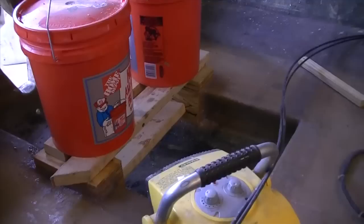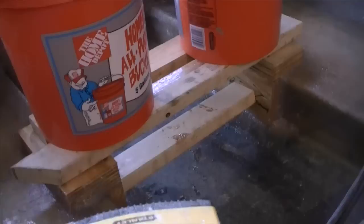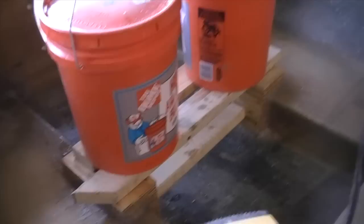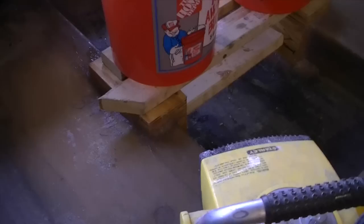As you can see, we got the motor mounts in and they are curing. I've got that 2x4 across this right here jammed in to hold it up against there, and it squished it all out, and we did a nice fillet in here. And once it's completely dried or cured, we'll take all this off and we'll take the grinder and a belt sander and really round off the edges. That way we can do our 1708 nice and neat.